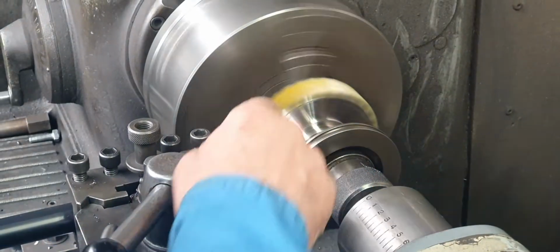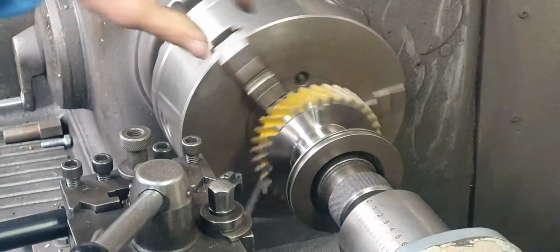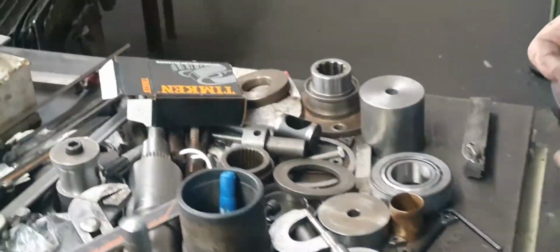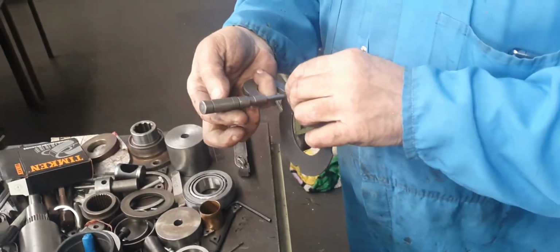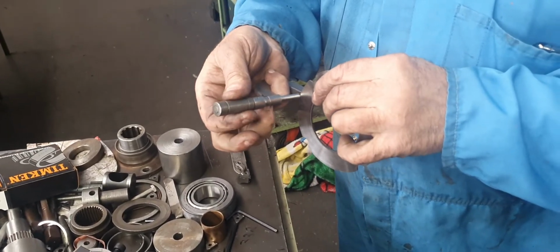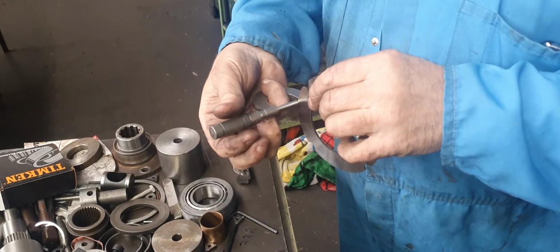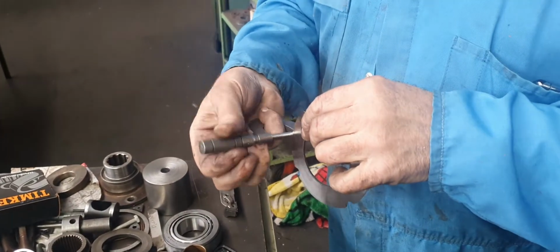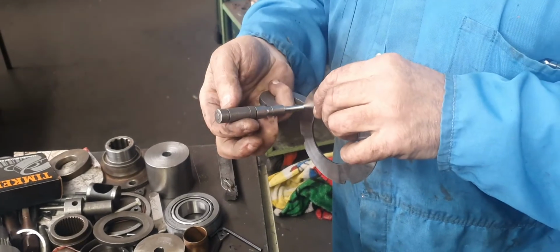Right now, should measure 60 thou this time. You have to press it in there like that so it becomes flat so you can machine it. One's 60 and one's 80. Oh, 62 thou. Within 2 thou anyway. Yeah, he can still use it like that.